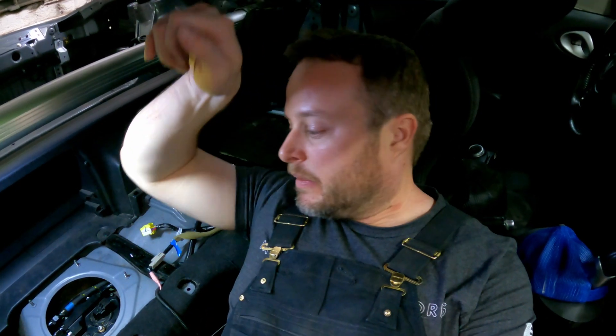If you want to get started, you don't have to watch this whole thing. When you run the venturi, make sure to go down the spine of your dual pump and then go up in between the two filters on the twin pump, then come up to the venturi and clip it in on the fuel hanger. I extended the hanger wire about a foot — having the assembly off to the side made it a little bit easier for me.